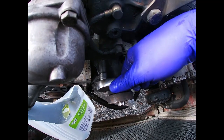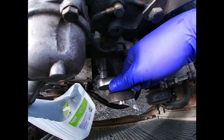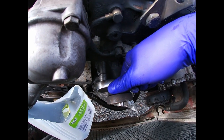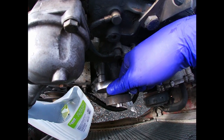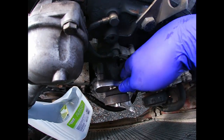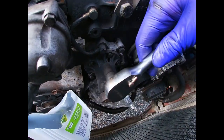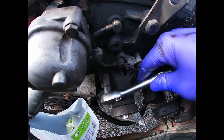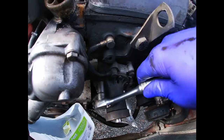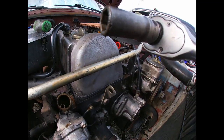That's why I call it like a massage. You have to massage the bolt. If you feel that it's gonna break or it's coming out really stiff, go back. Don't force the bolt, then give it a little bit of a break. It's gonna come out eventually. So the rest of the water pump bolts, the rest of the 5 of them, were fine, but just one of them was really stiff because the sealant got on the threads. But anyways guys, I'm gonna pull this thermostat off now.